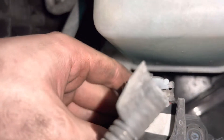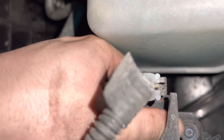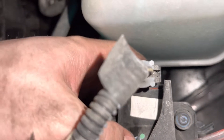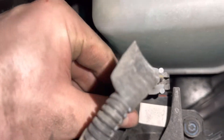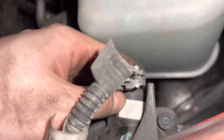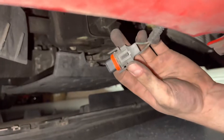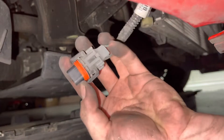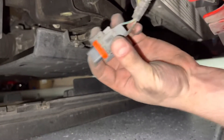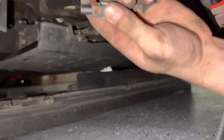After the plug is out, the bulb should be able to come out. There might be a bolt there but I don't think you need to touch it. To release the plug, pull these tabs outwards — try to do them at the same time and pull them down. Be careful not to break these, they break very easily and are not an easy replacement.